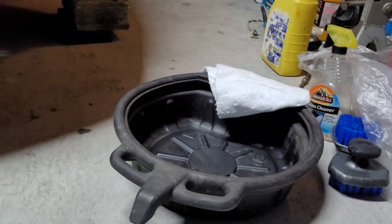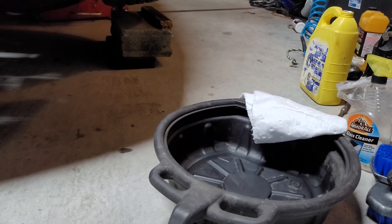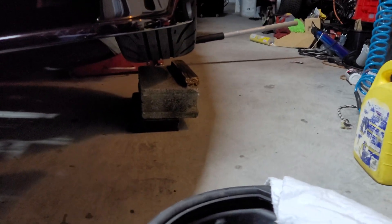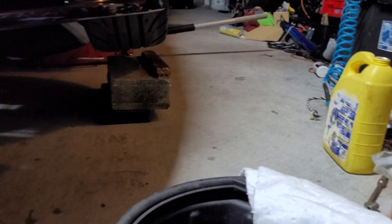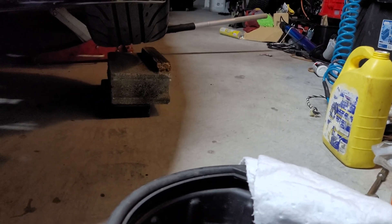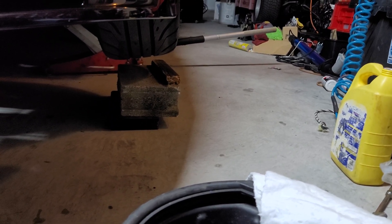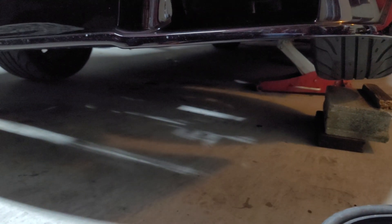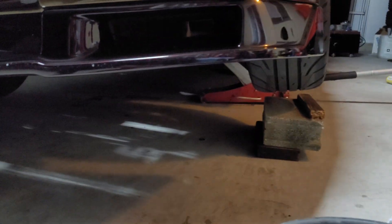I came back from a good drive today and I've probably driven around 700 kilos or so. What I'm doing now is a quick oil change. I'm inspecting some metal — not like bearing metal or anything — but metal from the piston rings mating with the cylinder walls, which is gonna create metal inside of there. It's known for a new engine to do that.